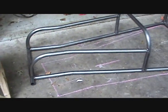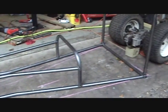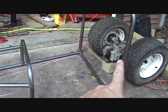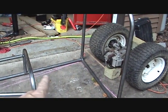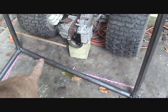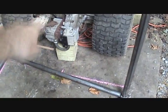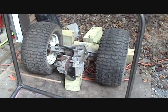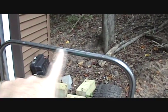So the project's coming along. I'll fill in some X-braces in here to strengthen this up, and then put a member in from this junction back to the main roll bar hoop, and that'll tie those two together. And then down here and over here are going to be some tubes coming back going underneath, or maybe over top of that transaxle, then curving around and tying into the top hoop up here in two different spots.